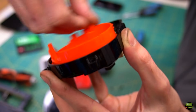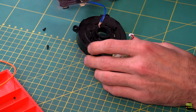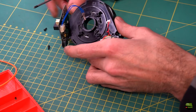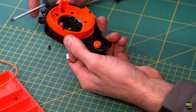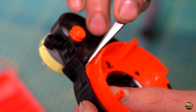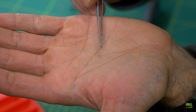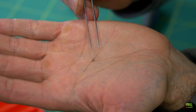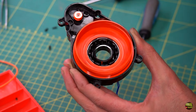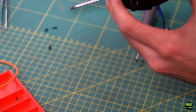Now I can freely remove the entire circuit. When I try to rotate the plastic manually I can feel resistance, more in one direction than the other. I also remove the back circuit to check the large bearing in the middle — and then I find the problem. There was a tiny rock between the orange rotating plastic and the black housing. Right after I remove that tiny piece of rock it starts to rotate without any resistance. All I need to do is assemble it back together.